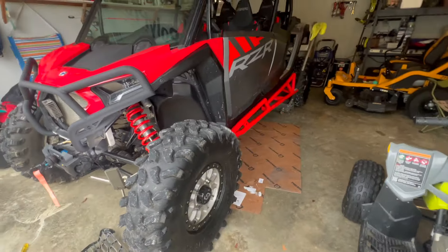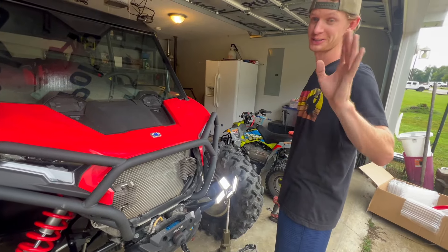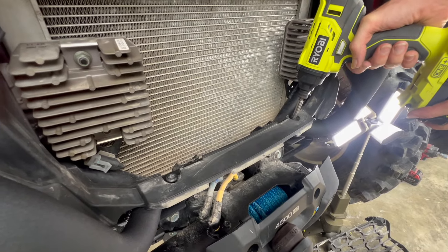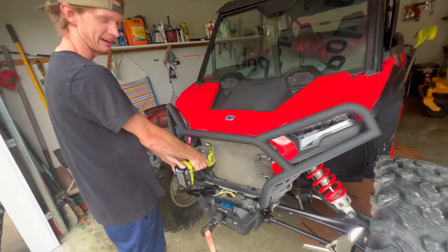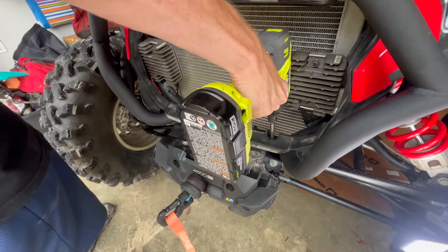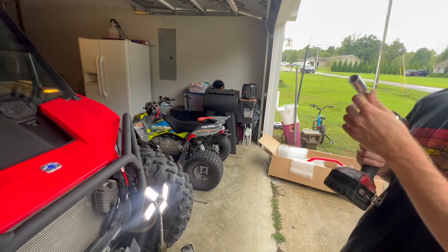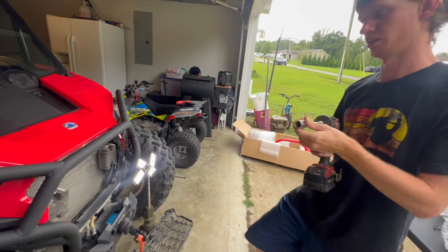Check out the new 33s on the beadlocks versus the stock factory tires. We're putting the T40 bolts back in — I got in trouble for starting before she started recording. Using this Ryobi tool: don't over-tighten because you're tightening plastic down. The fascia piece is solid now. Step two after the bumper bolts is tightening the two 15 millimeters on the lower frame mounts.